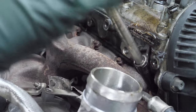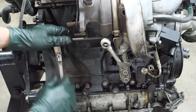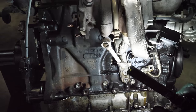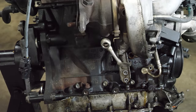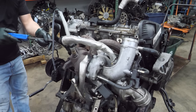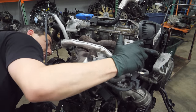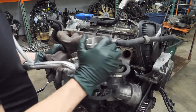Now we're going to crack the exhaust manifold. There is a turbo support bracket bolt — I have to take the whole bracket off. The nut is captured, and all the heat cycles from being bolted to the exhaust housing of the turbo have frozen it. I'm going to break my bit if I keep going, so we're just going to modify the bracket. Now it moves and we're off.